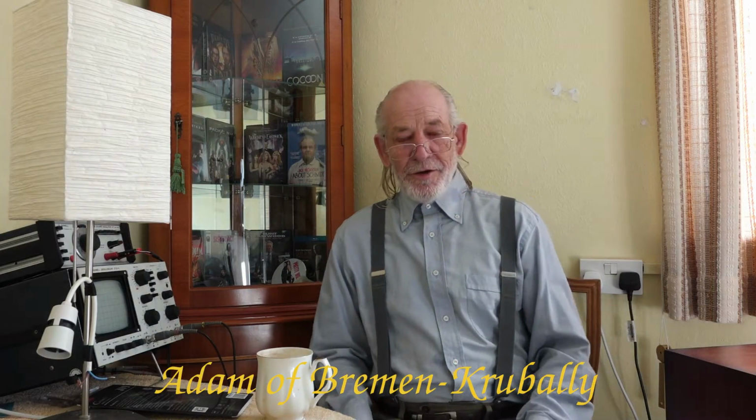Well, I'm on shore now and I'm planning my 3-battery electrical system, which is quite a mission actually, the design of it. Because in this video I lose all my electricity again and can't start my engine. I come to start my engine and the starter motor doesn't turn over. I tried the other 2 fully charged batteries with jumper cables, I can't get anything to work, and so I have to sail into rocky shore to find an anchorage in a sandy bay somewhere.